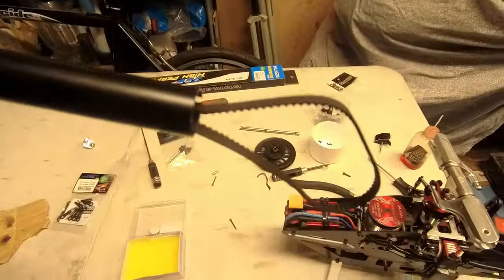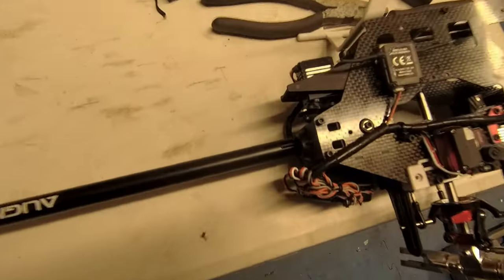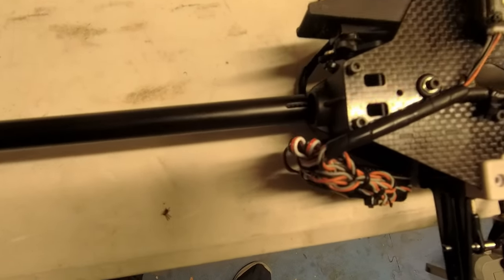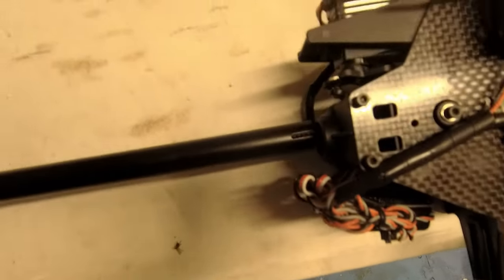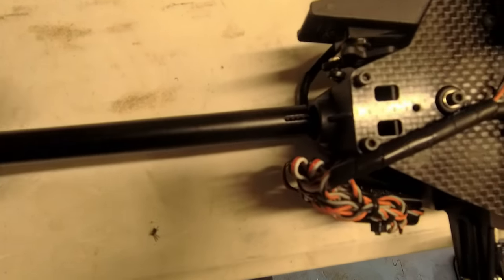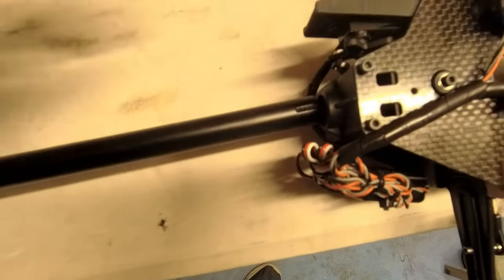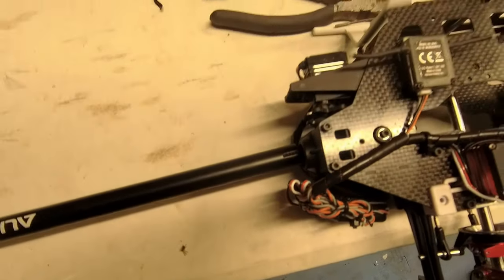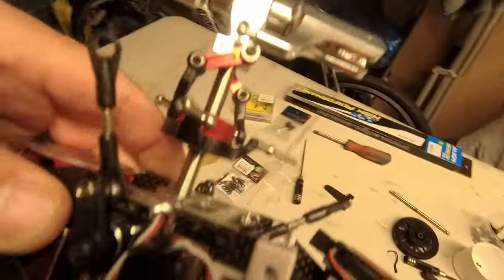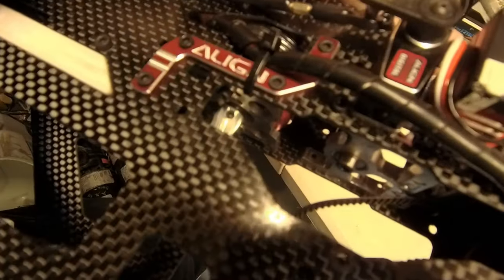All I've got to do now is attach the front to the body. Similar to the rear, we've got the slot going into a keeper slot. When you put it in you can feel it slide in - if it hits a stop it's no good, you need to feel it slide. Earlier we put the head in - now I'll take it out again. You've only got to take it out as far as about this, just so you can get the gear in.